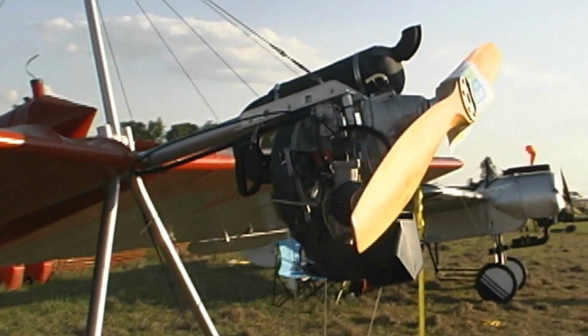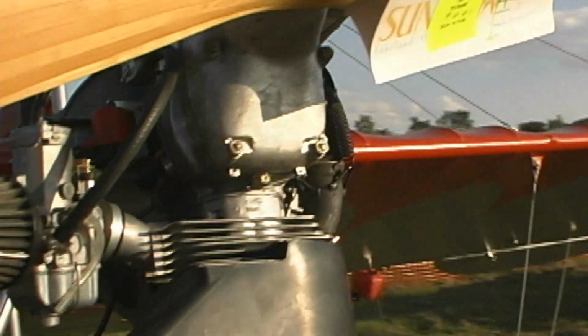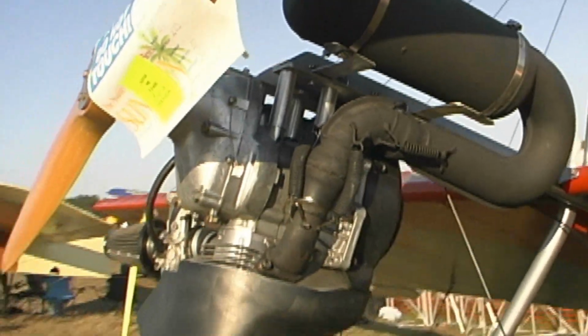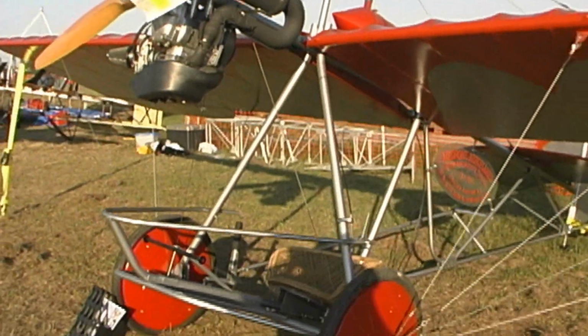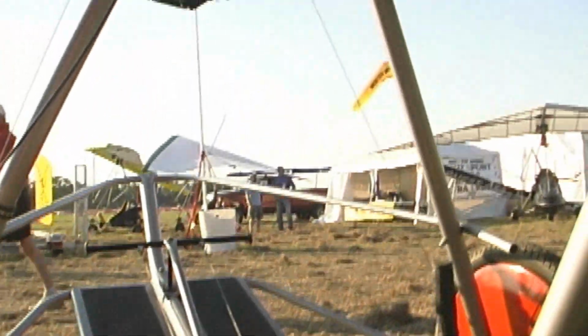Now, what about the wiring and the length of the wires for the king post and that type of thing? Okay, all the wires on this aircraft are actually built in place. After you build the wing spar assemblies and the fuselage assembly, we have a DVD that we make during the building of the aircraft, and we show you how to support the wings on wood pedestals, basically like bunk bed sets. And you take levels and you level the wing structure up, and then you actually fit the cable in place, and swage the cable. So the cables are built to the airplane specifically. It's not a production type of thing. It's a one-off home build, but we go over every step of that in our DVD.